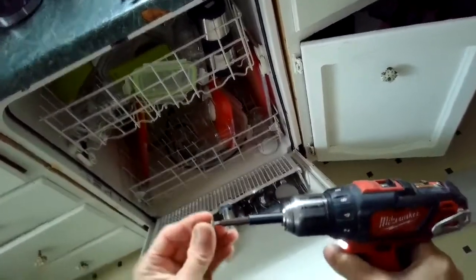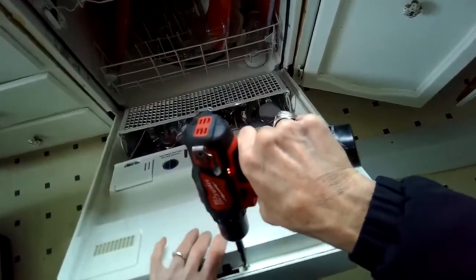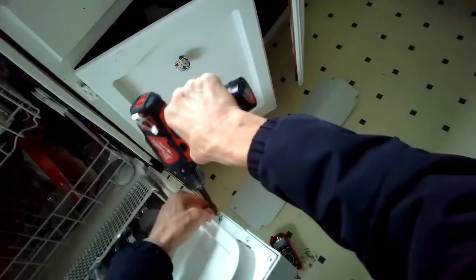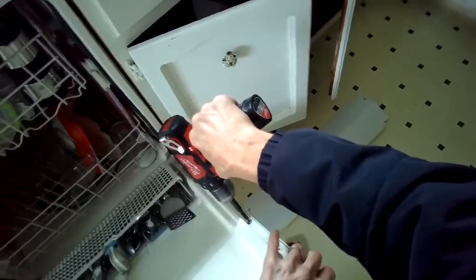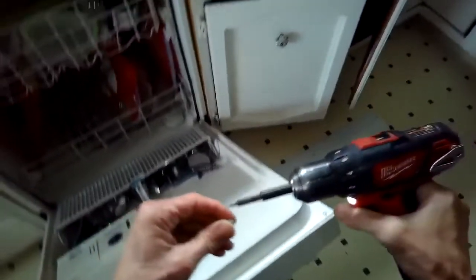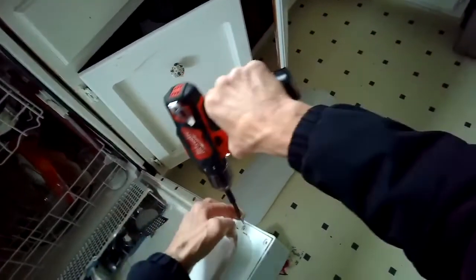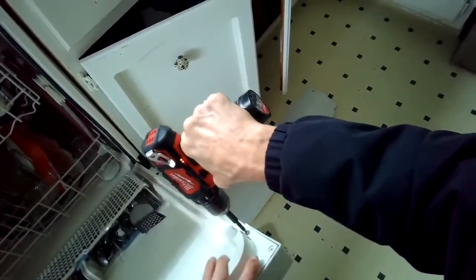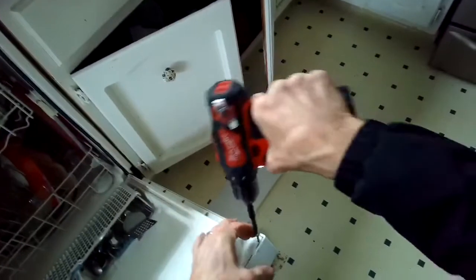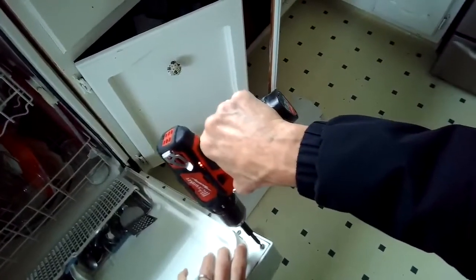So if you don't have a replacement fuse, basically banging the old fuse down hard against a hard surface like concrete or brick will often reset it. And what I did with this one today is I grabbed it with a pair of pliers and I hit it with my small hammer, and then I tested with my continuity tester, and I found that it did have continuity, so it actually did reset. Doesn't always work, but I'd say about 8 out of 10 times, about 80% of the time, it'll work.